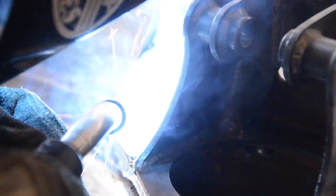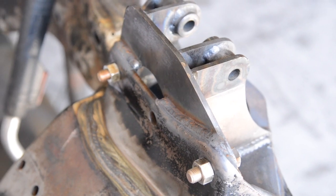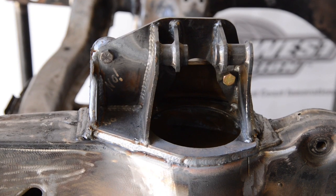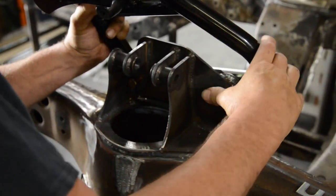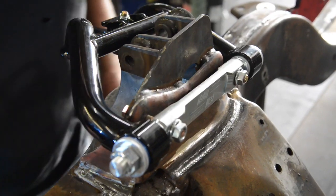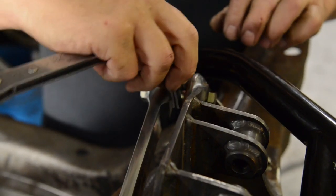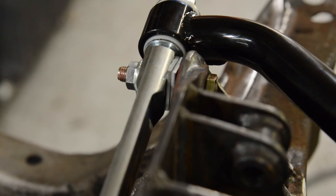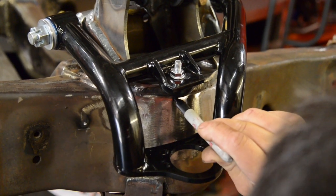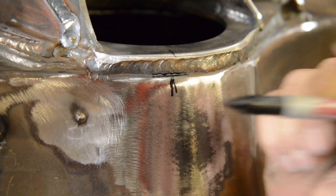Once this is all completed and you've welded completely around the extended travel mount, it'll be time to go ahead and put the bump stop on. You're going to do this by installing a tubular arm — the CTA-79A. You're going to put two 1/8-inch shims; that's the setup on the upper control arm and that'll help position the bump stop. Once you've got the 1/8-inch shims installed, swing the control arm down and you're going to mark the center line of the bump stop to the frame. That cross marks exactly where the bump stop is going to hit the frame.